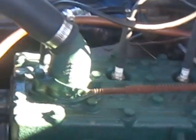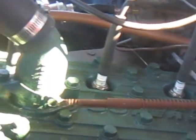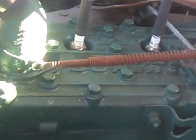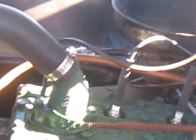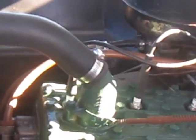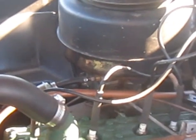It's running right now. All original under the hood, just the way I got it when I bought it about two years ago. It was sitting in the garage for like 15 years. I drained the fluid, rebuilt the carburetor, checked all the brakes, put tires on it, and that's about it.